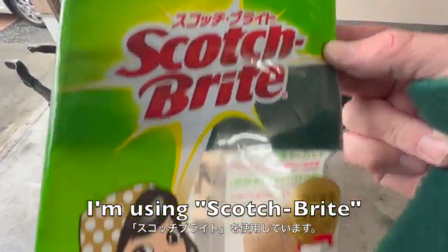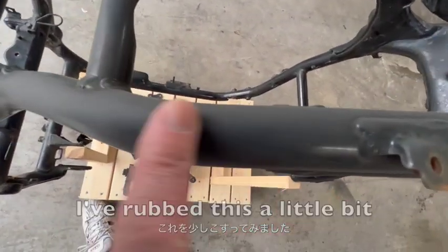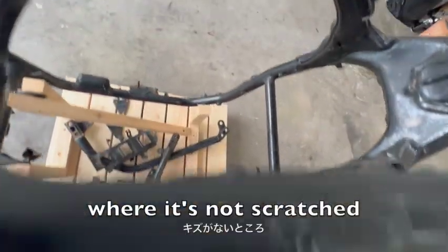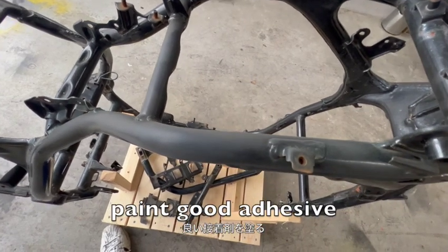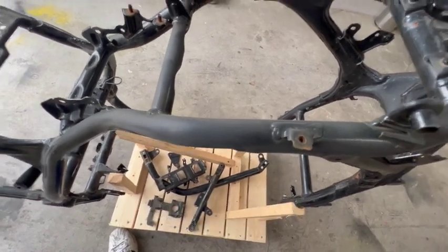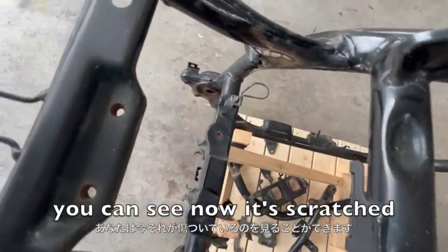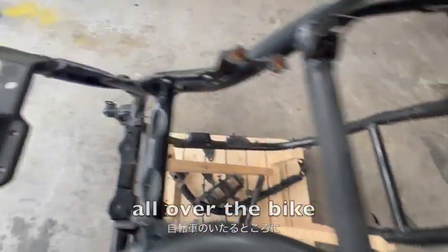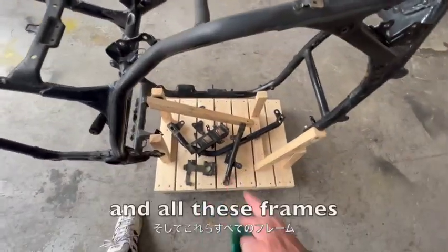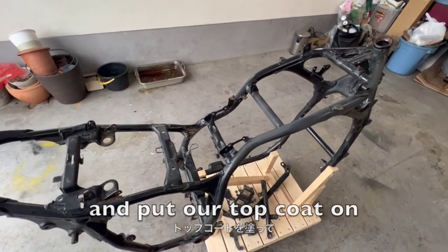To rub most of this frame down, I'm using Scotch-Brite - just 3M Scotch-Brite. Now, when you rub it down, you can see here I've rubbed this a little bit and you can see it's scratched compared to that side there where it's not scratched. So all you have to do is rub it enough so it's scratched, which gives the paint good adhesion and bites into that paint to stay there. Here it's not been done yet - and now you can see it's scratched. We've got to get it in here a little bit more, but we've got to get it like that, and like this all over the bike. And then we've got all these frames and everything done - we can put a bit of primer on the bits of bare metal and put our top coat on. So let's get into rubbing it down.